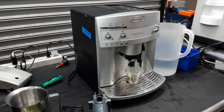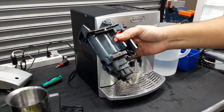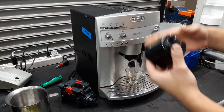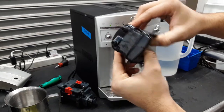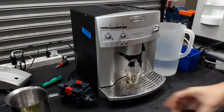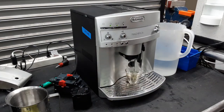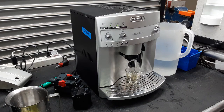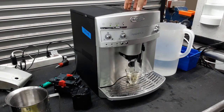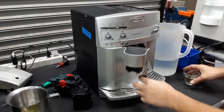We also had to do a tune-up as this machine had a lot of coffee built up inside. This is the old brew unit that was in there, and these are the old spouts — we had to replace them. As you can see, these ones are broken from the middle, which is very common with this machine, but pretty easy to replace. We also descaled the machine, cleaned the hopper, cleaned inside, replaced the gasket from the generator, cleaned the doors, cleaned the spouts, and cleaned everything inside.